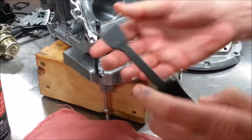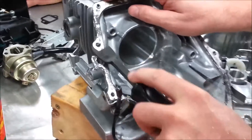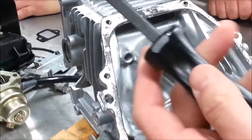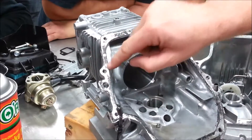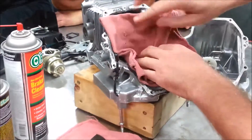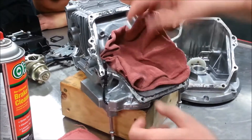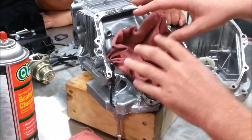The proper way to use this tool is flat side down, handle up like this, and you basically take and scrape the gasket material off. Am I putting any pressure? No, I'm putting no pressure. What I don't want to do is gouge or hurt the surface at all. You can see all the excess here — I'd rather get it dumped out here and outside of the engine rather than putting gasket material on bearings or surfaces where I don't want it.